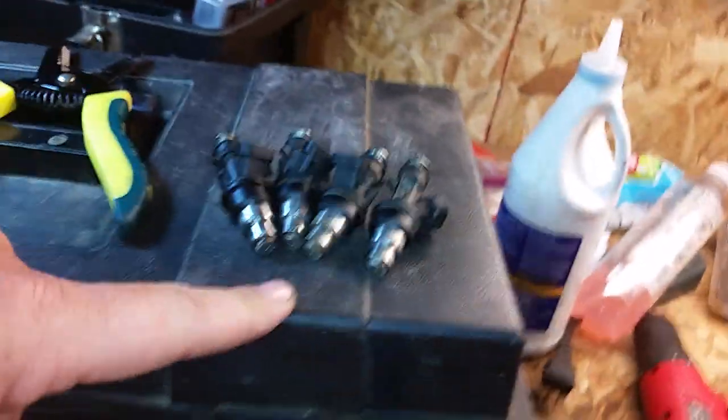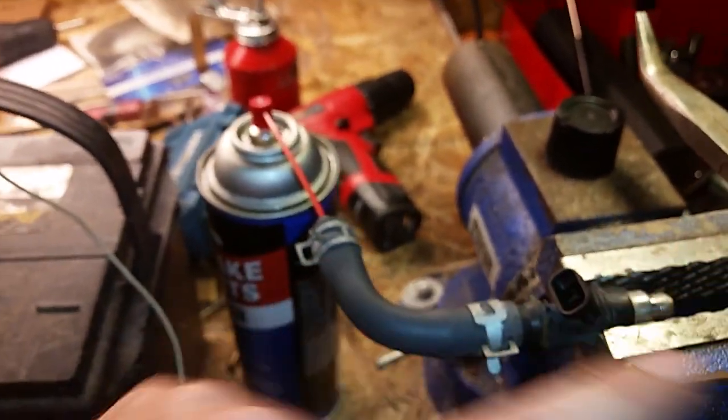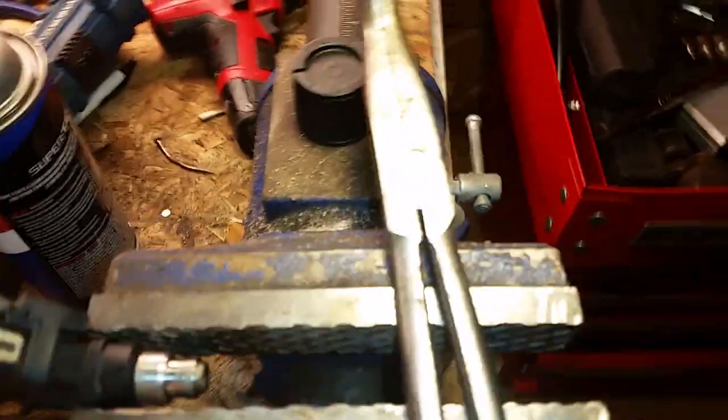I kept seeing online guys saying oh they get so many that turn out bad or don't work. These work to the best of my ability to figure that out — the spray pattern looked alright, about as good as you're going to get from this type of nozzle. Here's how I'm going to flow them and test if they're open and closing. Okay, open and closing pretty good — but this one's got a pretty goofy spray pattern, it's not shooting right. That's weird. Luckily those first four actually shot really good, but this one is not.